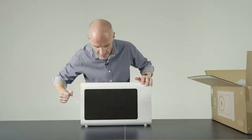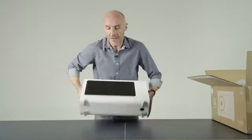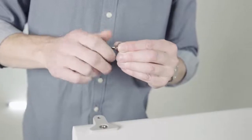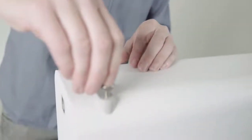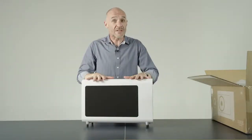There's a 20 centimetre driver under here and it's powered by 150 watts of internal amplification. At the bottom, four little feet which all accept a floor spike. Nothing is worse than a subwoofer that sits straight on the floor, because those bass frequencies just want to move downwards, and the more you decouple it from the floor the more encouraged they are to come forwards or sideways or backwards — anything but down. So I will attach the floor spikes and then put their little rubber feet on. There we go, standing on its feet ready to go.